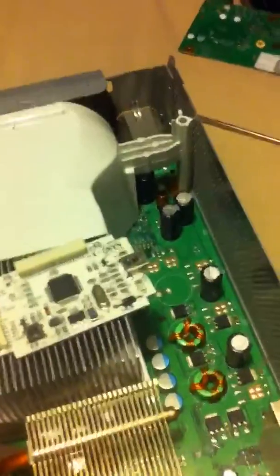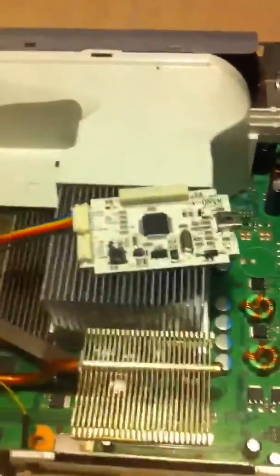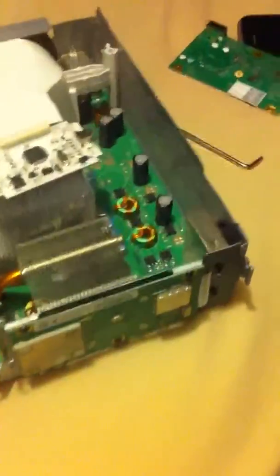It doesn't have a drive — I repair them and this one came in as a repair. I couldn't find a drive or get it fixed, so the guy just sold it to me for 20 bucks. Then I lost the drive, so I'm going to try to do it without the drive. By not having a drive, when I JTAG it I can get the CPU key — basically the DVD drive key. Then I'll put another drive in it, probably going to go with a BenQ drive, after I get the key and get it JTAGed.